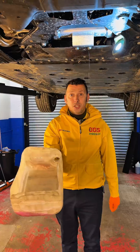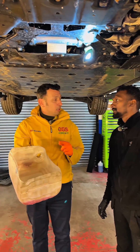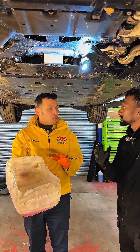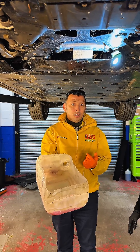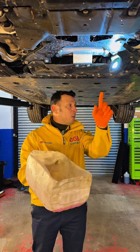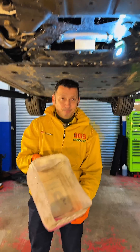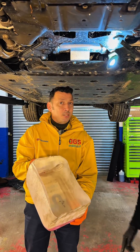So if coolant gets drained regularly it could extend the life. Obviously it should not happen in the first place, but look — clean coolant into the electric side of the engine, never been checked. We are probably now in the position of a failed motor. The issue was with the motor — it drives, no noise, but massive coolant loss. I'm pretty certain this is also going to have corrosion on the position sensor, very common, very bad.